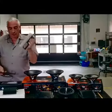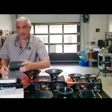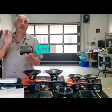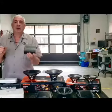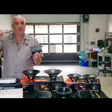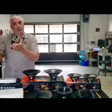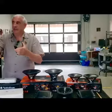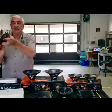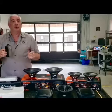4-channel, 100-watt second amplifier. We get these from Hogwired out in California — excellent company, USA made, top of the line, high end. We get a bracket made for us for the road glide. This goes on the side of your pod. Your speaker pod comes out, this bracket goes in there, and this amplifier mounts right on there. Now you have six channels at 100 watts per channel.